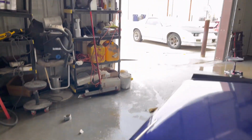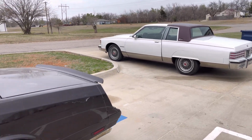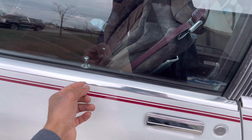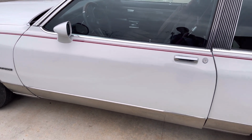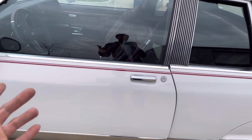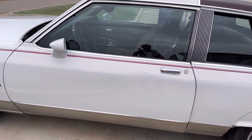As a matter of fact, we had it happen today, kid you not. We literally had to fix the Bonneville. We pulled the Bonneville, let the customer know it was ready, and then my cousin accidentally did the same exact thing on the door, and I'm mad I didn't get to take a picture of it, but right here it was ripped up, and then I tried to touch it in to see how much of a difference it would be, and it just was a no-go. So we literally rolled it back in here, scuff sanded that area, masked it up because I got pearl in here. So trying to get it to match that spot was really challenging. We had to play with it, come back, take a step back, look at it. Okay, it looks good. And then we went ahead and cleared the whole door. So this door got cleared earlier today.